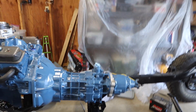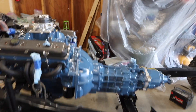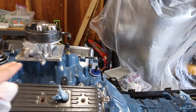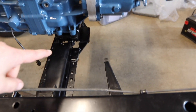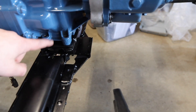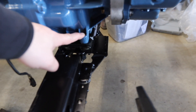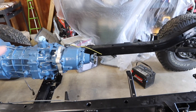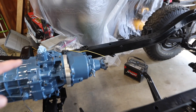I put the clutch assembly on the transmission but I didn't like the angle — it was sitting up too high, and the top plate was tilted forward, which you don't want. You want it level or slightly back. So I had to fabricate a Scout crossmember. It's not pretty, but it's flat from the bottom and I spaced it out so the AX15 mount fits on the transmission. It's cobbled together but super sturdy, and that's the adapter from the AX15 to the transfer case.